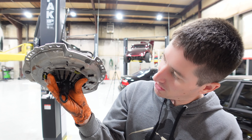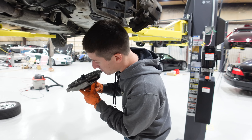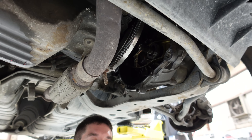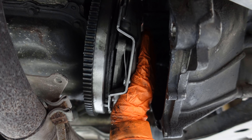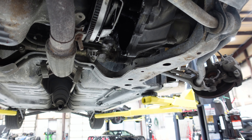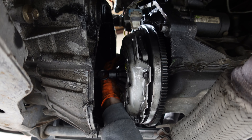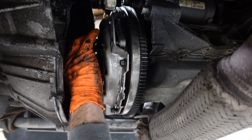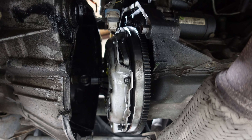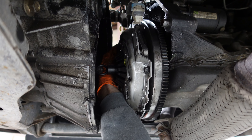We've got our clutch alignment tool hanging out in here, and the new clutch is sitting on the pressure plate so I don't have to touch it — we are ready to get this thing in here. I also took all the bolts over to the parts washer and cleaned them up. There's not enough room for the tool, so I'm going to have to bump the transmission over and out of the way, then I can get this thing to actually line up and start tightening it down. Let's put one bolt in so this thing doesn't fall on my head. If you look where the alignment tool is sitting, we've got a nice bite — it went all the way in and sits flush with the fingers on the pressure plate. You'll feel a nice click when it engages. Now I just need to get all of these holes lined up and then we can start evenly torquing down the actual pressure plate.